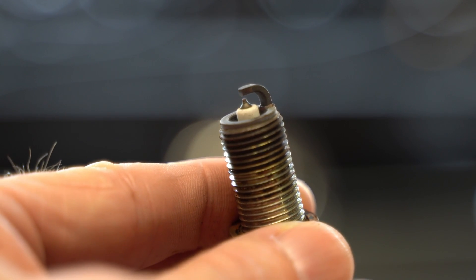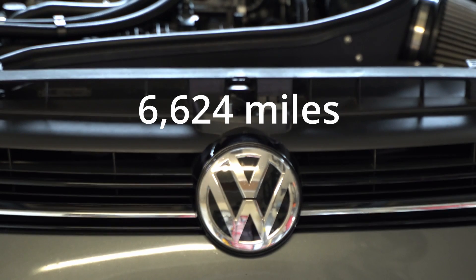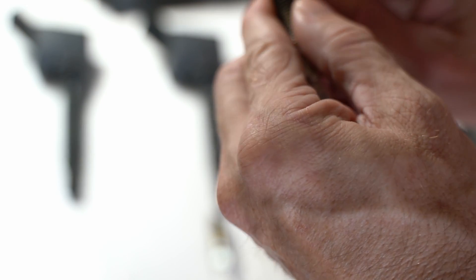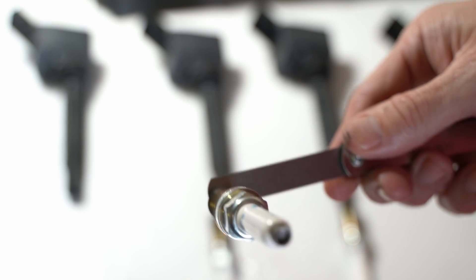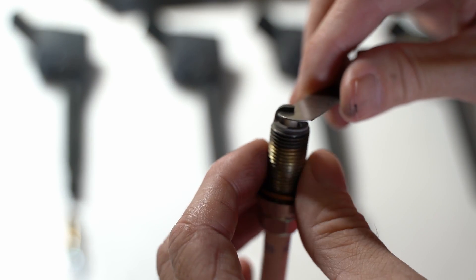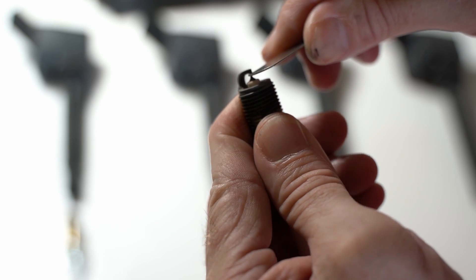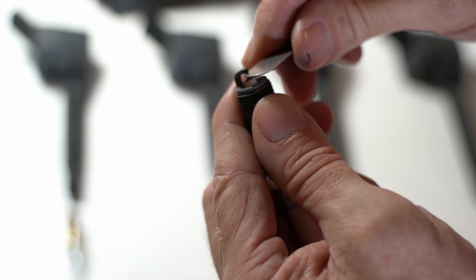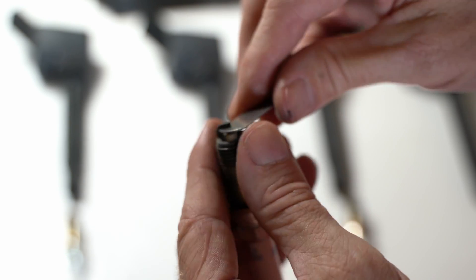I'm pretty happy with these. I don't know exactly how much mileage I have on these — maybe 10,000 miles, maybe a little bit less. Now I am going to check the gap. They're gapped at 0.024 inches. Basically I want to make sure the feeler gauge is snug enough that it sort of holds on to the spark plug, but just barely slips in at the exact measurement. If it's got too much room it's gapped too wide; if it doesn't fit, it's gapped too narrow. Because it fits in there just barely, all of those are good.